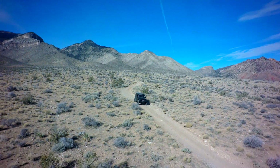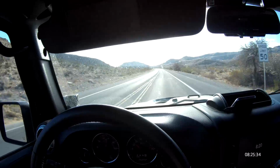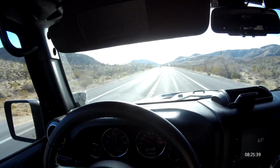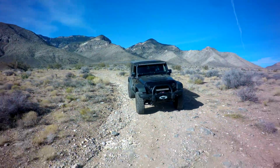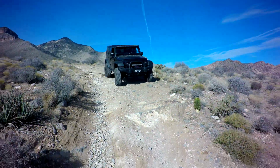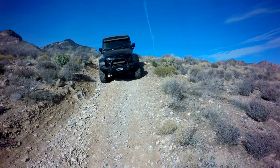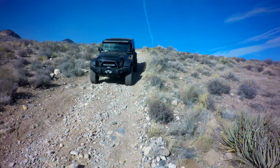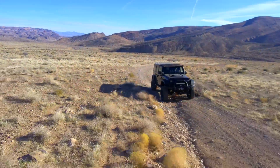Now, the Hemi guys have made a lot of progress making the monitors pass. There's several approaches. One is to actually use a Hemi computer and allow the monitors to run and set the way they're intended. The compromise with that is the interface to the rest of the vehicle. If you go with a V6 computer and import the Hemi operating system, there can be compromises there with the transmission and Mode 6 data. So the Hemi on the electronic side, I would say, is easier to interface than most of the other options because it's a Chrysler product.